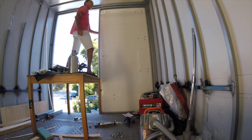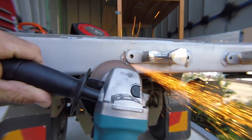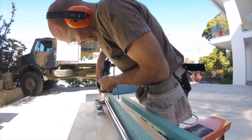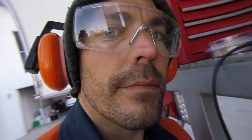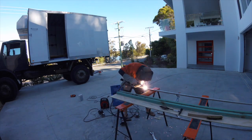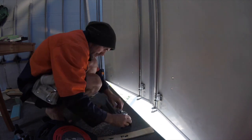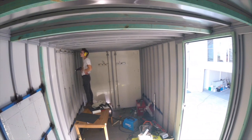Timon and his dad, aka Papa, removed the outside stainless steel locking handles and all the associated hardware. He then cut them down to size and, with the help of a jig to keep them straight, welded them back together so we could re-fit them on the inside of the rear doors. He welded the catches to a bit of square tubing and welded them to the roof and floor respectively, so we can open and close Mogli from the inside.